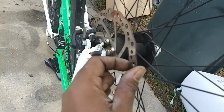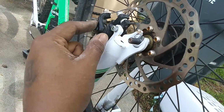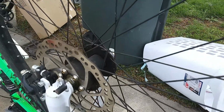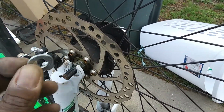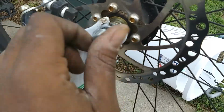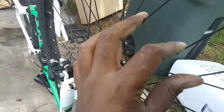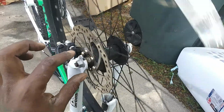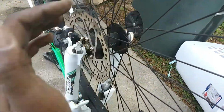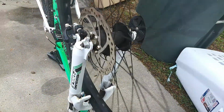Okay, this particular bike, I had to make sure my rotation matched the orientation of my caliper, or really where my pad was, to put the caliper on the right side. So I slipped the caliper in right there, and on that side I've already put in my retaining washer. Bam, bam. When you're installing your tire with the caliper, you shouldn't hear anything. That's good. Make sure you tighten your bolt enough, whichever side is the tighter side, to where it won't rub. Nice and quiet.